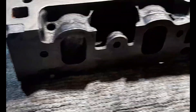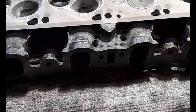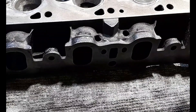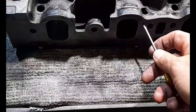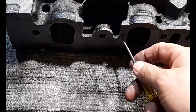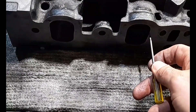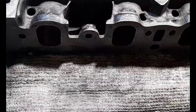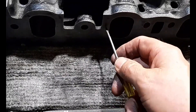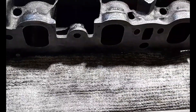In the next video we will attack gasket matching. Lots of arguments say it's an absolute waste of time — it depends on who you listen to. I have to do it because the large exits of my intake manifold are so large they will sit over the intake hole and cause reversion. So I need to at least gasket match these. When I put the gaskets on you'll see there's a bit of material to take out — just an inch in is all we're going to enlarge, but that's enough to put my intake manifold on and have a proper port match. Because the exits were hogged out by the previous owner, it will sit around the port opening and air will hit on the sides, risking reversion. So I have to open these up a little bit for my intake manifold.